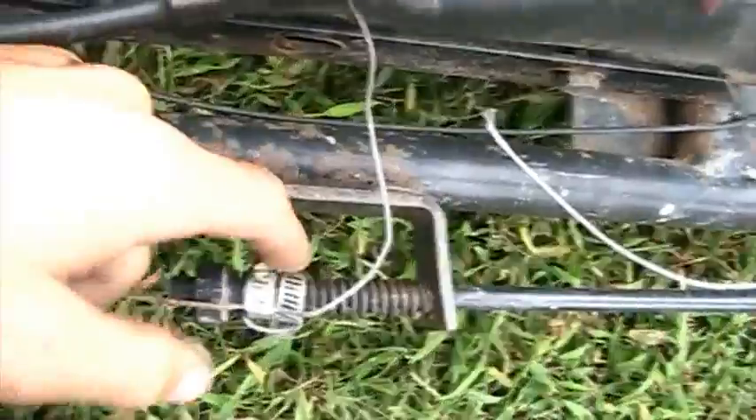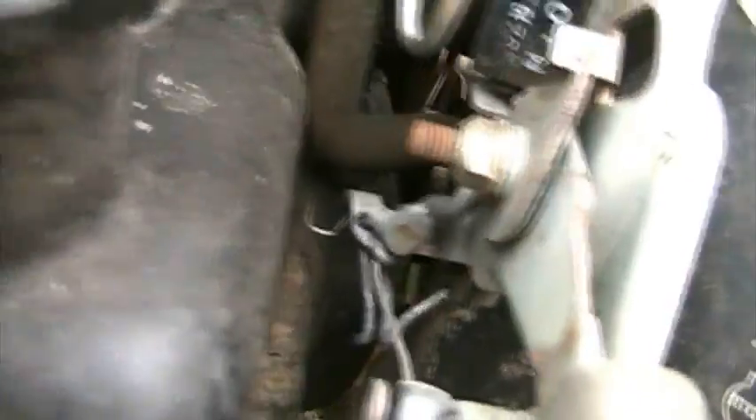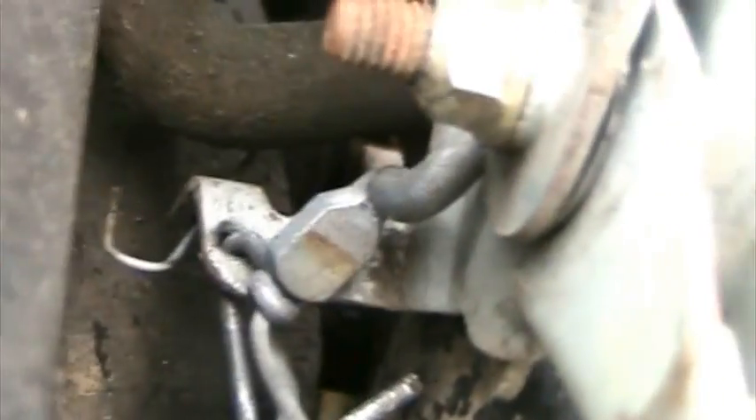You can't do away with the throttle cable — you have to have it up in here. Just do it like this here, and that way it will work as the throttle return and throw it back down to idle. If you look there, I had to take a piece of wire, loop it through there, take the Z-bend and do it like that, then loop it around and crimp it on there tight. As you see, how the throttle return works is that spring kicks it back down to idle — it's that spring that does it.